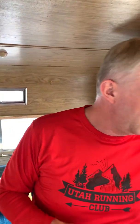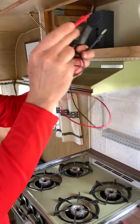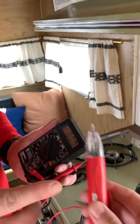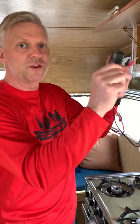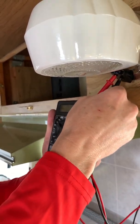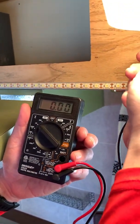I always need a multimeter too. If something isn't working but I'm getting power there, I take this off, turn it to volts, and check if power is getting to that specific point. How is this different from the little non-contact stick? The stick tells me in what general area there's power — kind of like a metal detector. The multimeter lets me pinpoint it: I can touch two wires and test if there's power at a specific spot. It will say negative if the leads are the wrong way.